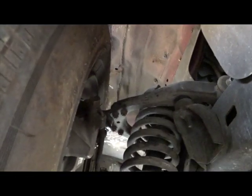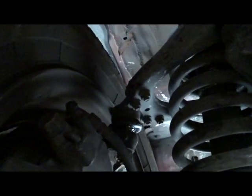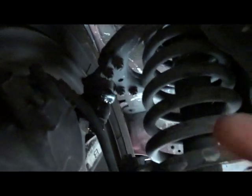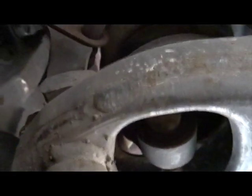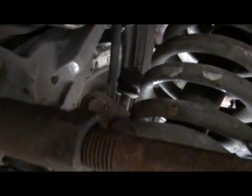As you can see, that's the coil — it's on the bottom and on the top. If you're watching this because you want to do it yourself, you're going to have to take off the upper arm screw, which is a castle nut with a bar through it — that one right there. Then you're going to take the shock out, which has two bolts right there, and then take the upper one — you can see it right there — and then the shock will fall. The spacer is actually up here.